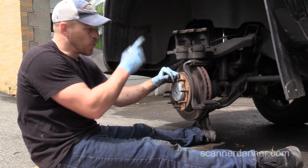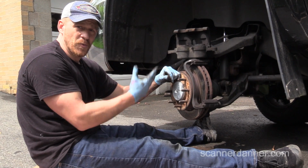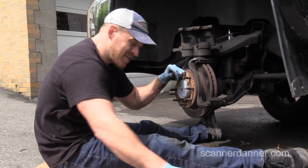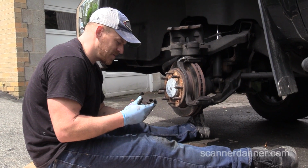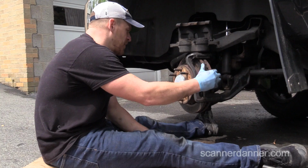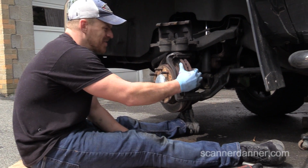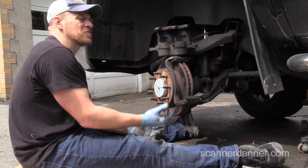I do, however, want to know about my right front caliper before we go to the parts store. And as I'm talking, I'm thinking about, man, do I want to change these front pads? I need to. They're cracked. But then I don't want to put front pads on these rotors that have a ridge. I don't have a way to cut them here in my neighbor's driveway.